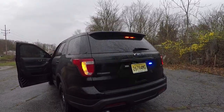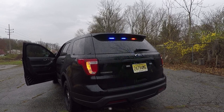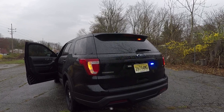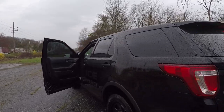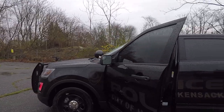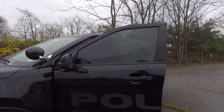Let's look at some of the other safety features we've added to the vehicle. With the turn signal on, we can shut off the hideaway mounted there to allow somebody following you to know that you're turning. We also do this for the brake lights. Another feature is that we shut the under-mirror light off when the door is open so that the officer is not blinded when they get out of the vehicle.